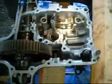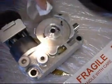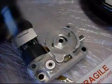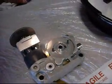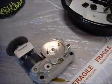Let me show you the damage we did to the center case trying to pry it up without removing the pin, which is on the main shaft — number 35 in the schematic. It simply holds the center case up against the bottom of the case, spring-loaded. But we damaged the internal section — that's okay because we're going to replace it. That pin is inherent to the K66, because in the three videos I watched of the K46 being disassembled, that was never a part. So keep that in mind.